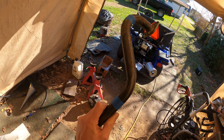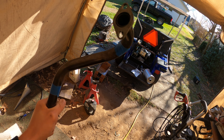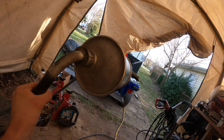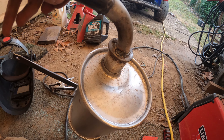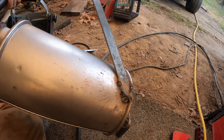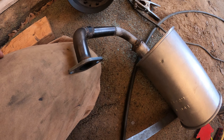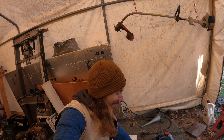With this existing header, I'm going to take this bend out so it'll just be a straight pipe from here to up there — that'll give me more room to work with. So I got to cutting. I took a washer and welded it to the top of the exhaust and the pipe fit right in there. I also made a hanger that mounts to the engine directly so this thing won't be bouncing around. I cut and used the old exhaust pipe from the other motor and did some scab patch work — it's a whole hot mess but it's gonna work.